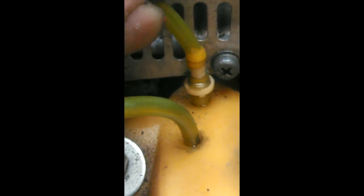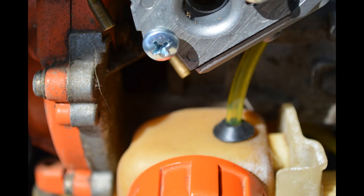So I tried the rubber grommets, which are from other Stihl products, which you can get online or go to the dealer. With that grommet, I recall the drill bit being like 11/32, but don't quote me. You can start small and try shoving the grommet in there. All in all, the rubber grommet makes it last a lot longer, personally, before you start seeing air and gasoline leaking out from where the hose goes in.